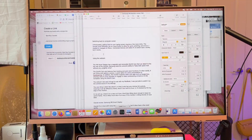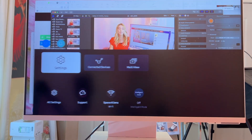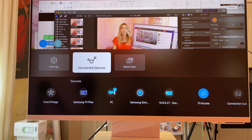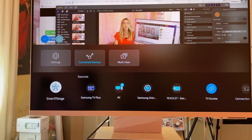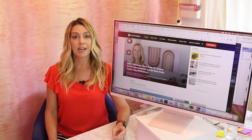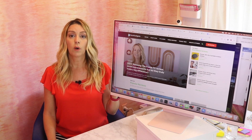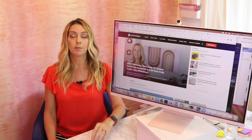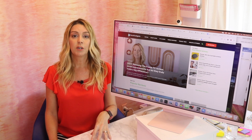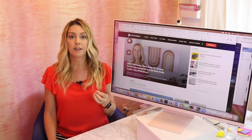Oddly, choose PC. Though it shows PC as the source, this will be whatever computer you have connected, even if it is a MacBook. With that selected, you should see your laptop screen appear. Then you can use your MacBook's settings to either make the monitor an additional display or a mirror of your existing laptop screen. Using your MacBook's system preferences, you'll go to Displays, and then you can arrange the windows as you like.